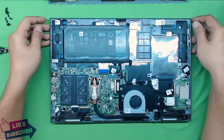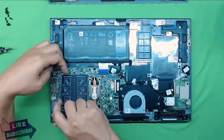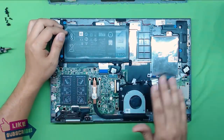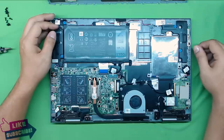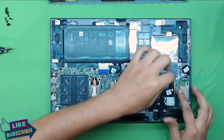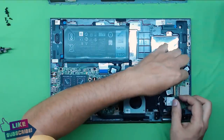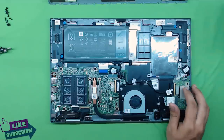Now this is the inside of it. You've got your RAM right here — you can add extra RAM in this model. You've got your speakers, your battery, your Wi-Fi board, your CPU, your heat sink fan, and your hard drive. The reason the Wi-Fi stopped working is because the flex cable that connects the Wi-Fi card to the main board was slightly off, so you just had to push it back in to fix the issue — it wasn't a big deal.